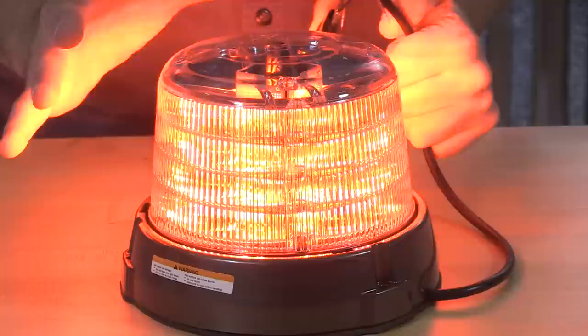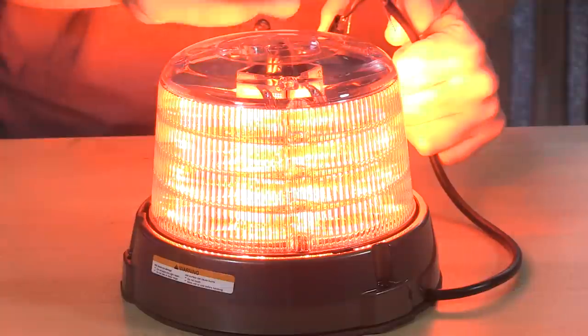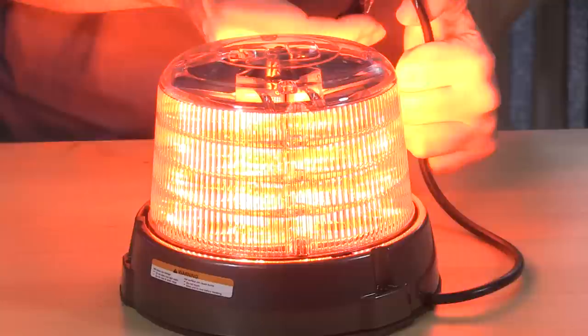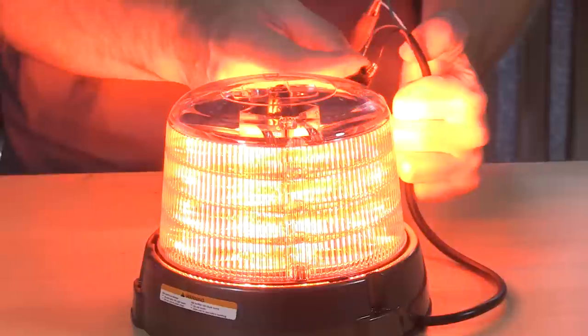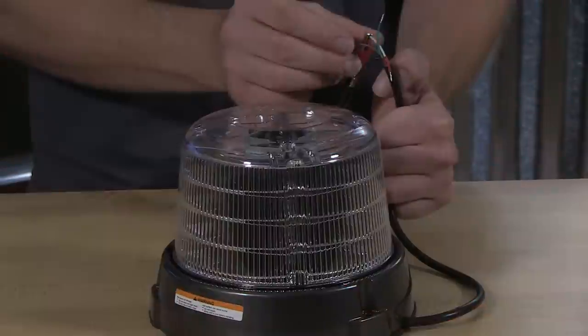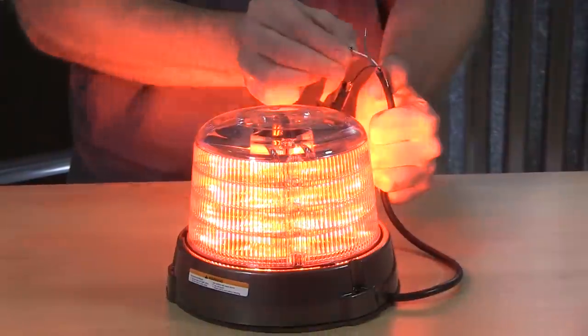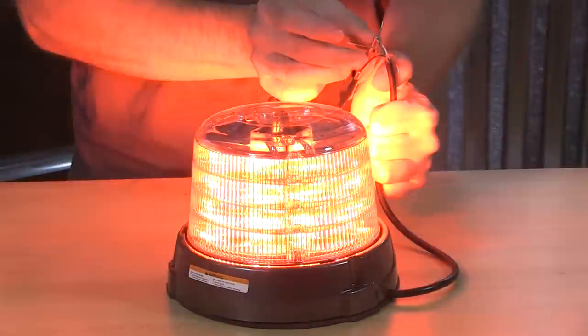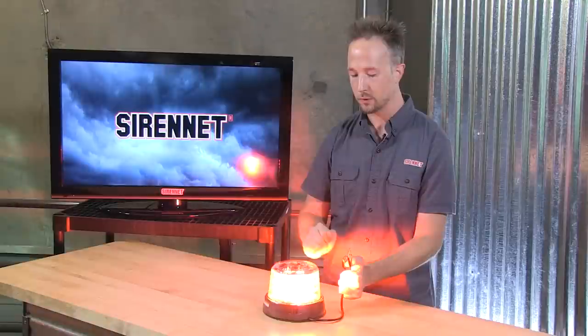For night time, as you can see, this is very, very potent. You have the ability to put it into a low power setting — that's going to be done by continuously applying the brown trigger wire to a 12 volt circuit. So as you can see, night time appropriate and daytime appropriate modes. As long as the brown wire sees its own 12 volt power source, low power latching — that's how it's going to work for you.